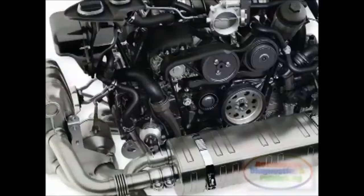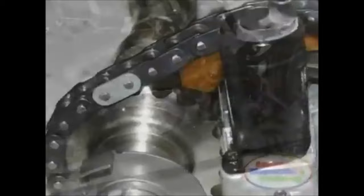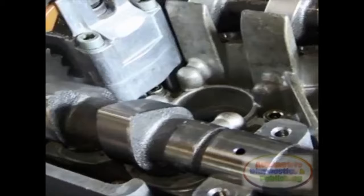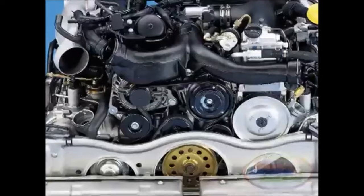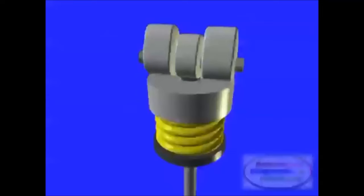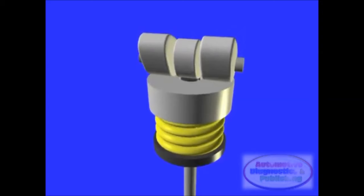Porsche Variocam Plus Valve Timing. Variocam is an automobile variable valve timing technology developed by Porsche. Variocam varies the timing of the valves by adjusting the tension on the timing chain connecting the intake and exhaust camshafts. The Porsche Variocam was first introduced to the Model 968 in 1991 on the 3.0-liter engine. It used a timing chain to vary the phase angle of the camshaft, thus providing a variable valve timing scheme. The 996 Carrera and 986 Boxster also used the same system, but further refined. The Variocam Plus, used in the 996 Turbo, finally executed the trend of using hydraulic cam phasers instead of chain.